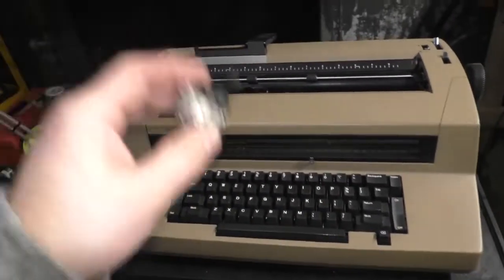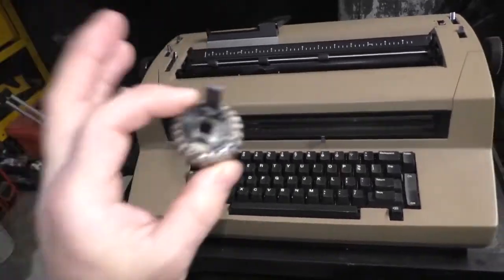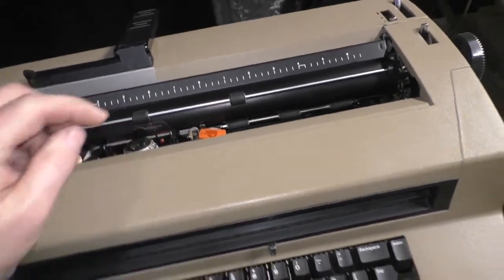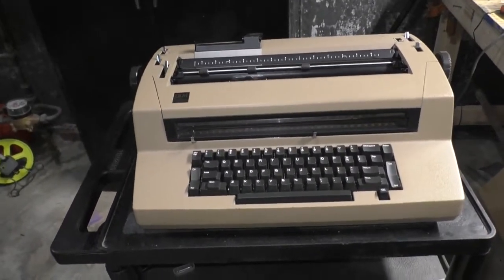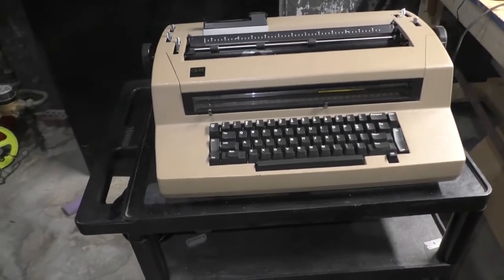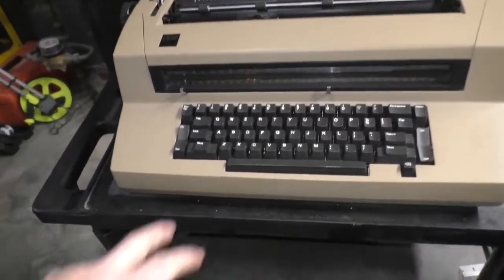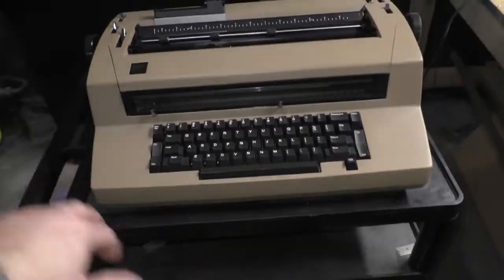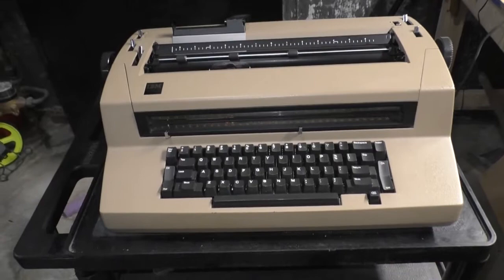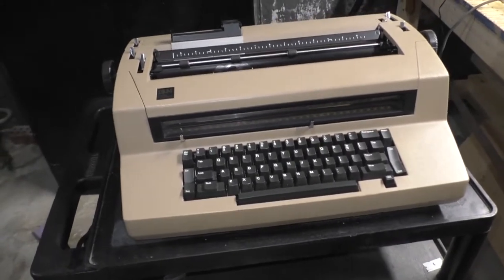The other thing is, if the daisy wheel typewriters were invented earlier, these probably would have never existed. What makes these unique is that they are, for all intents and purposes, a fully functional digital to analog mechanical computer. Yes. They are classified as a mechanical computer in how they function. I know that's a lot to unpack, but that's what they are. A mechanical computer takes input from the user and performs calculations using levers, rods, fulcrums, and in this case, Whipple tree mechanisms to achieve an output. It's wild, man. And the video that I post in the description of this video will explain exactly what that means.